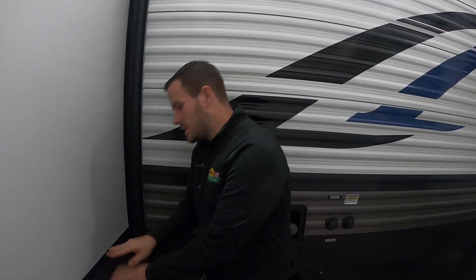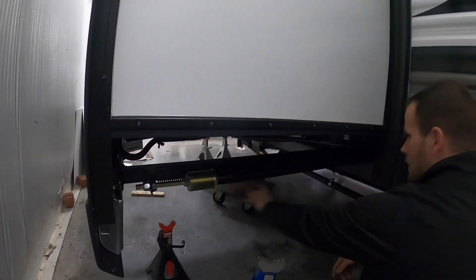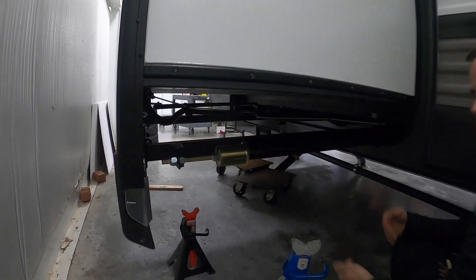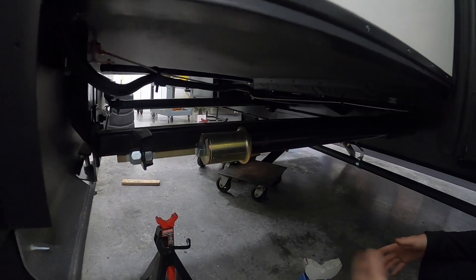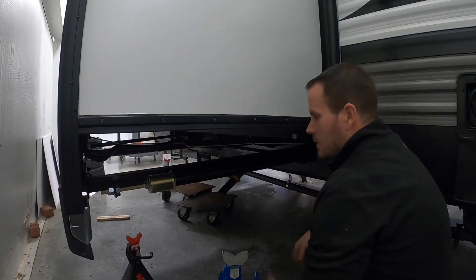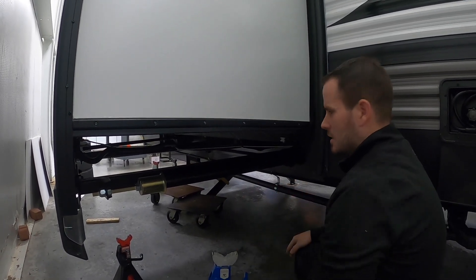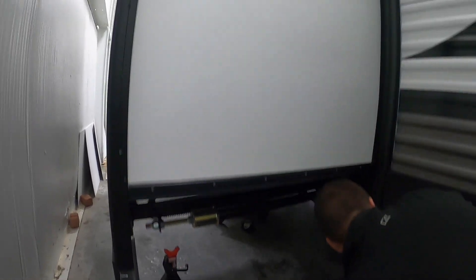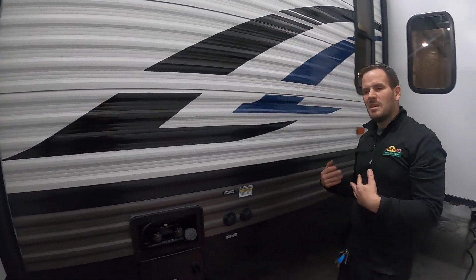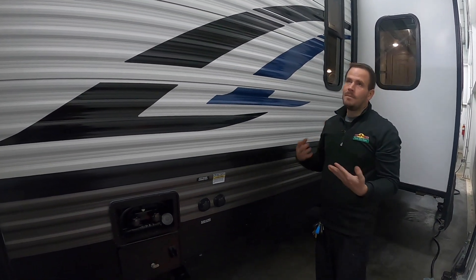On this style of slide, it's a rail slide. Underneath you have a big gear and rail going into a motor. You'll want to lube under here with the teeth using RV dry lube — spray it on those teeth every six months or more. When it does move in after you spray it on, run it in to help get the lube around the gears. Those are your two biggest points for maintenance. You also want to sweep off your slides before you run them in — tree limbs, walnuts, anything like that can damage the seals and rubber.